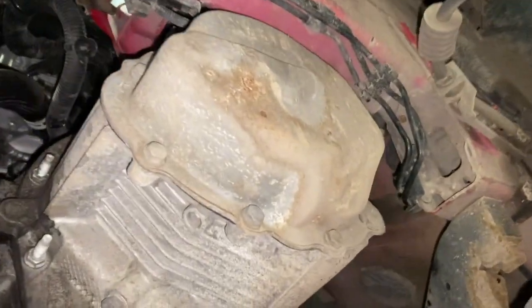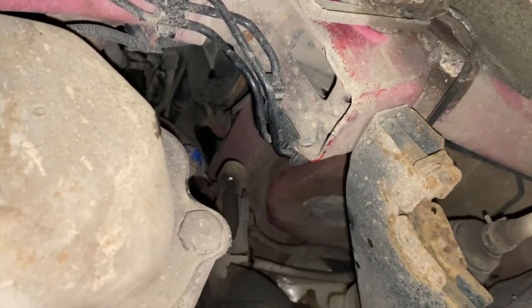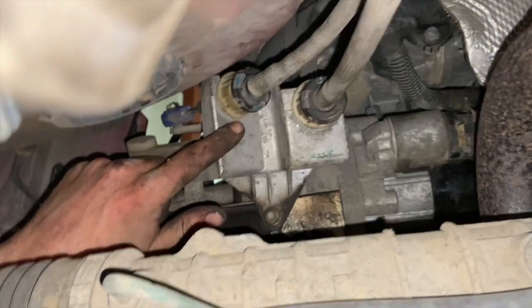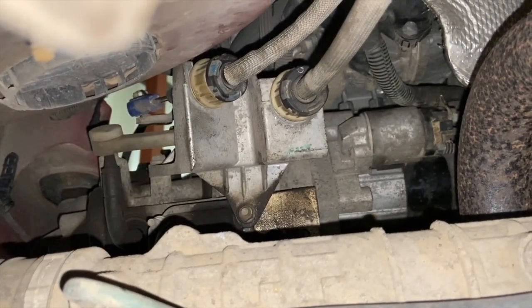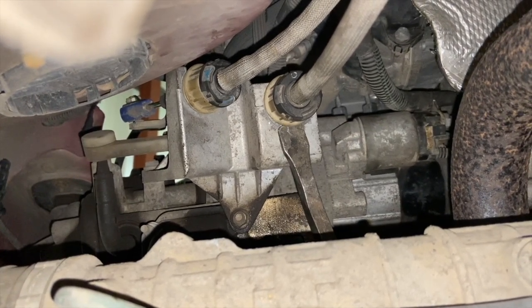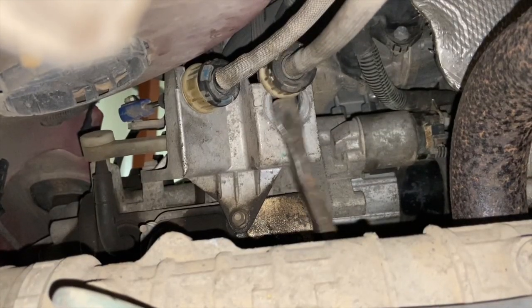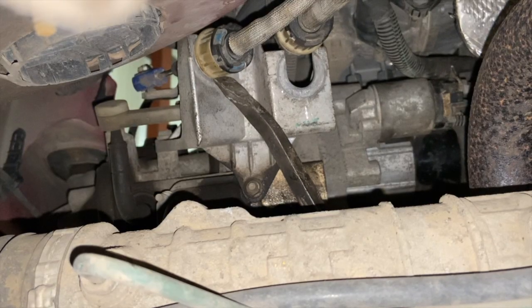And just before unclipping the cable from the top, we'll actually just get the support bracket out, because it'll probably be a little bit easier from underneath here. But if you just see on the cables, plastic housing bits there, basically you just need to work that and pop both of these out. They can get really tight, because often they've been left and not been taken out very regularly, but all you need to do is work your bar in, give it a gentle tap and they'll come out. They are quite a tight fit, so you can just get your bar right in the gap.